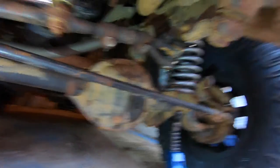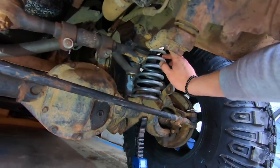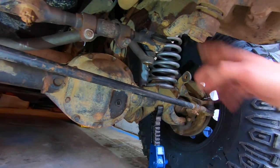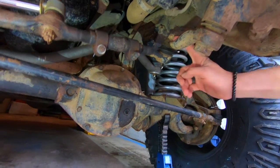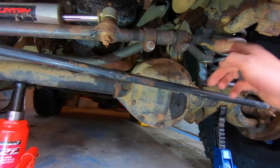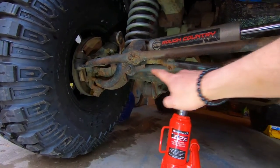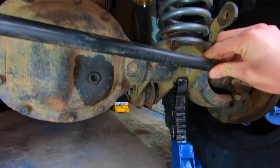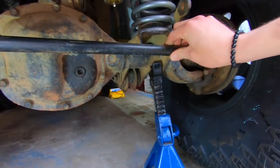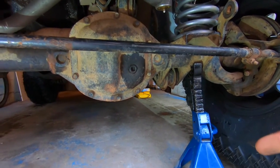Before I get it down — what is all this stuff? This is your steering box right here. Basically you have your steering box connected to your pitman arm. From the pitman arm you have your drag link, which connects all the way from here to the passenger side wheel. Then here you have your tie rod. This is quite a small tie rod — it's still the stock one — so I will be upgrading it for durability and steering stiffness, which helps with bigger tires.